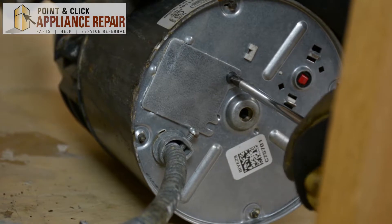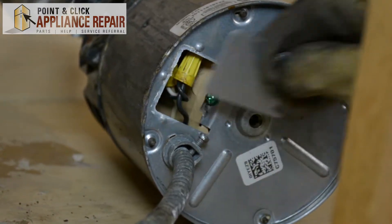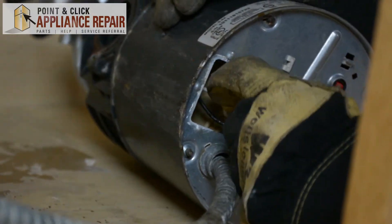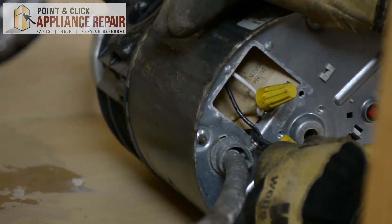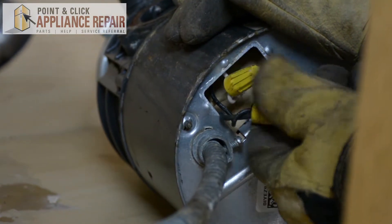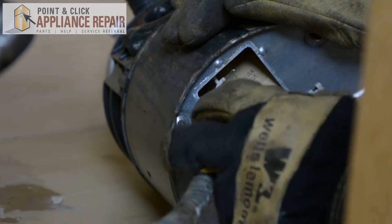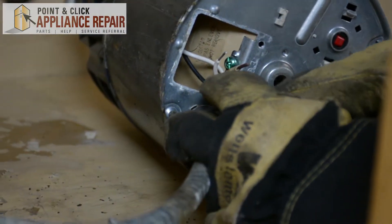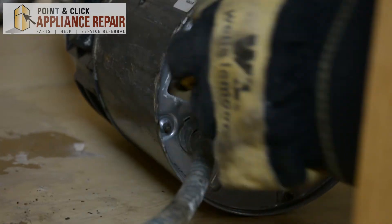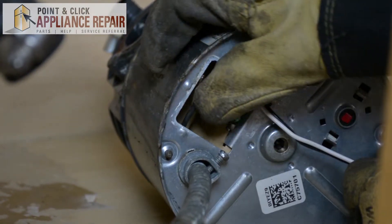Now that we've got that down, you've got to get this screw out and get into the panel here. I'm just going to pull these out and show you. You can see right here the way that these are connected — it's got a couple of wire nuts on it. So you're just going to unscrew the wire nut on both of these, untwist the wires and separate them. These ones go into our old disposal and these are the ones that go into our outlet.